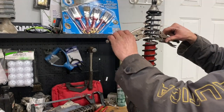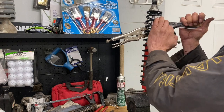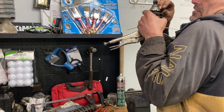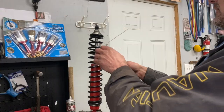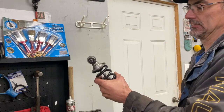I compressed the spring with two pairs of vice grips and put tie wraps here. I'm going to tighten them down and bring the spring down a little bit, then push this down here. You might be able to find a seal with the right thickness without using that spacer, but that spacer worked for me. I'm not going to be jumping big hills with my bike, but it'll run perfectly fine on the road and for small hills.